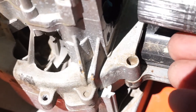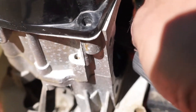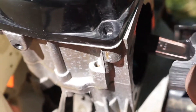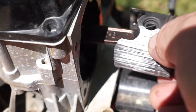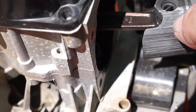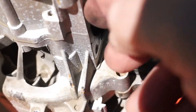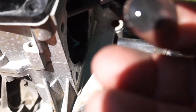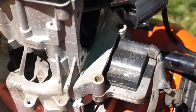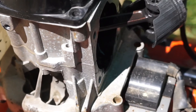There's still hope for it — the rod bearing seems to be nice and tight, and the piston wrist pin bearing seems to be good and tight. So there's a chance we may be able to replace the piston, wrist pin, and cylinder jug and put this back together without too much expense. You can see there's a little bit of goop down in the crankcase, so before we decide to do it we would definitely clean that out.